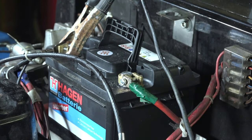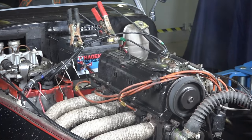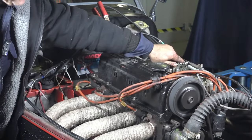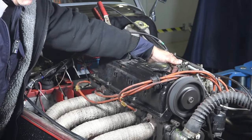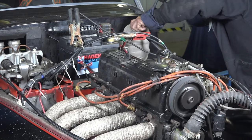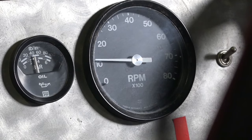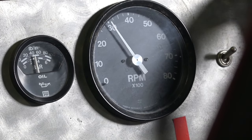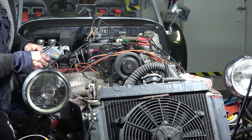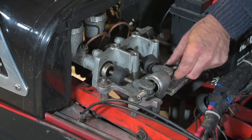Now we are ready to crank it up for the first time. It doesn't run very smooth yet. Don't forget to check the cooling liquid even when the engine is running — it looks all right. After doing some adjustments to the engine it started to run fairly well, but I still had to double check if the thermostat was opening at the right time, so I used an infrared thermometer to see when it would actually open up.